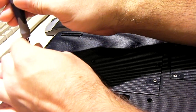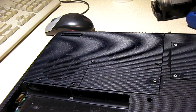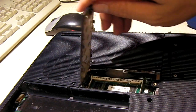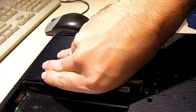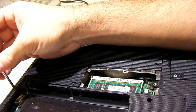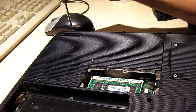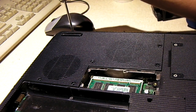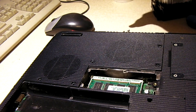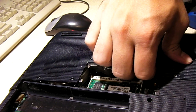Intel, for a while, even I think with the socket 478, had some older laptops use a mobile variant of the CPU. I'm not sure if it was even classified as mobile; it could have been something like a 1.6A. For those who are kind of familiar with the older Intels, when they released the Northwood Pentium 4s, in addition to the ones that were clocked at the 133 bus or 533 Netburst bus, they also released some CPUs coined as an A series, like 1.6A gigahertz, and those had just a 100 megahertz bus and a 400 megahertz front side bus. I think those may have been more geared toward low power draw applications.